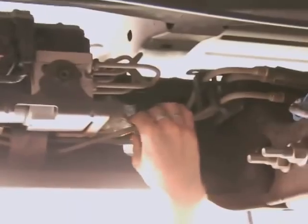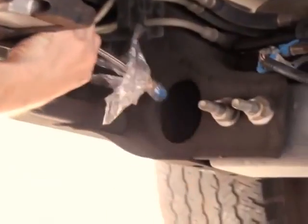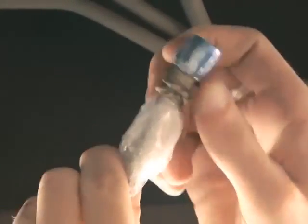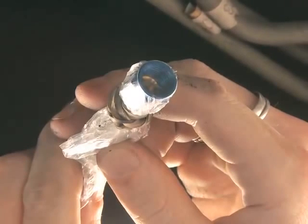Ultimately, you might want to choose a path that allows you to use the included hose length. Again, underside paths following the fuel line are recommended for most applications. Before you run the hose in the interior or along the undercarriage, wrap the end of the hose with a couple layers of plastic wrap or a small plastic bag and secure it in place with a rubber band to keep debris out of the open end of the hose.